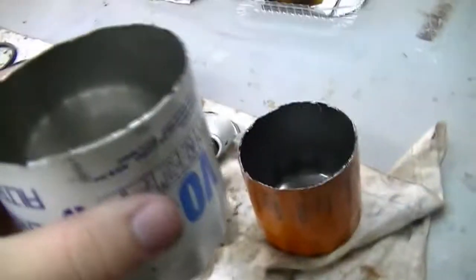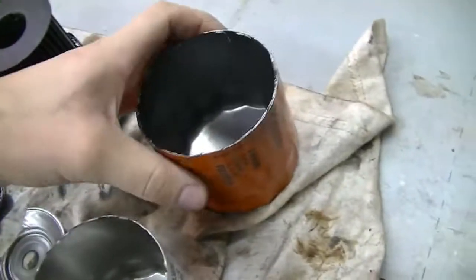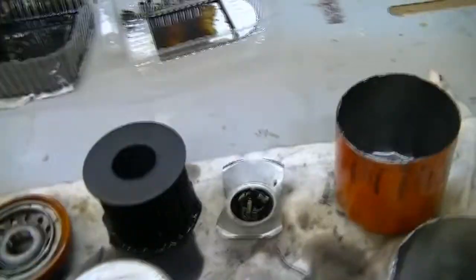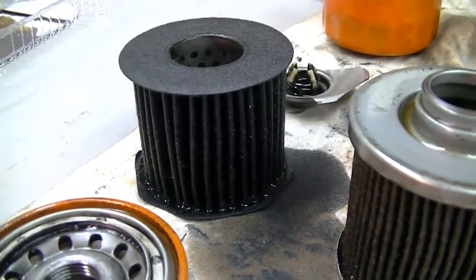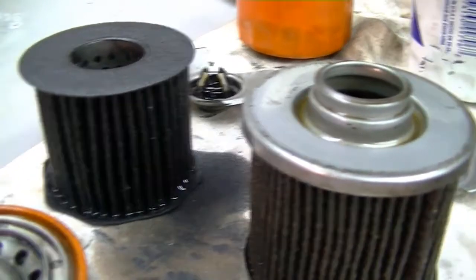Then there are the canisters. Just going by thickness — the Valvoline's doesn't take too much to bend it; I'm not really using too much effort. The Fram is definitely thicker — takes a bit more. Even so, both are plenty thick to use. The only argument people have is that if it gets hit by a rock moving at high velocity it may damage it and start leaking oil — but I really don't think that's going to happen. Yeah, these two filters are not too much different. I guess people consider the cardboard end caps the biggest difference — that's what people don't like about Fram. But these held up very well. This Fram has been used way more than a typical filter would be on a car, so I'm pretty impressed. Hopefully the new Fram I just put on the tractor — a current-day one I bought a couple weeks ago — holds up just as well as the one from a decade before did.